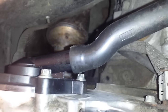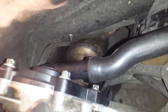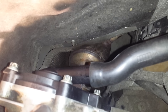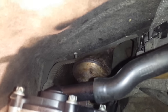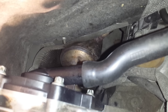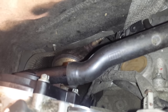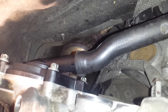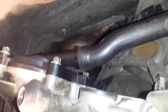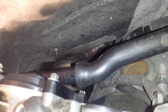Hope this video was helpful. This is the crankcase pressure release valve, and you want to change this out regularly because it does wear out, it leaks, and it can cause your air intake manifold flaps to get clogged. Hope this video was helpful — subscribe so you can get other video notifications, thumbs up if you like this video, and if you have any questions, complaints, or suggestions just let me know. Thanks — don't forget to subscribe.